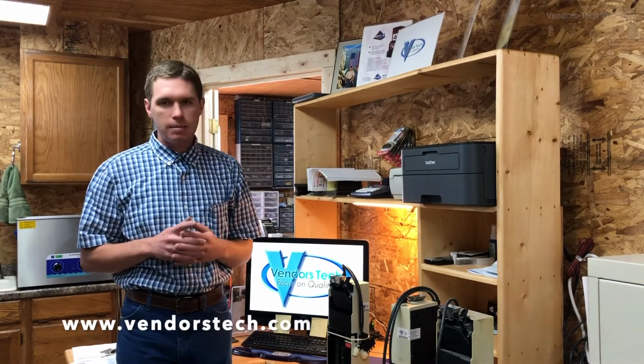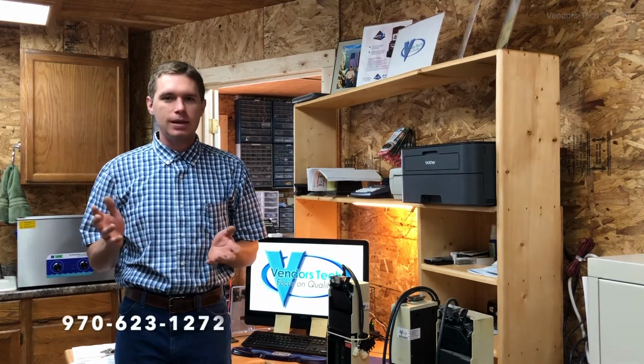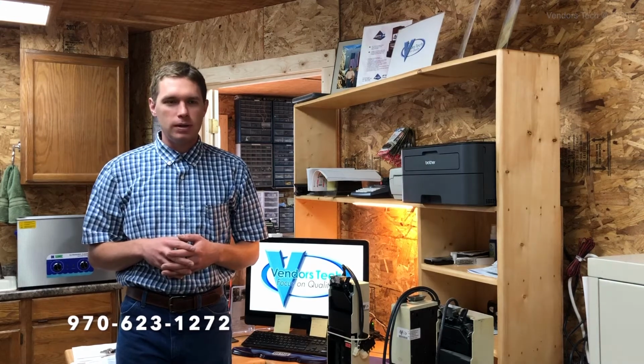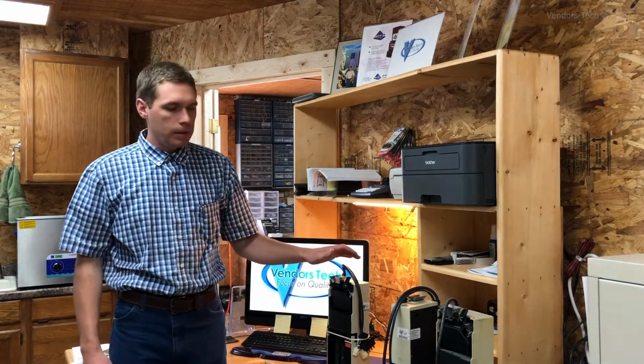Wanting to talk about the MEI TRC series coin mechs today. And unfortunately, the party on these is pretty much over. The MC series coin mechs have been junk for a long time. There's just no way to repair those. Those were discontinued way back, probably in the late 80s, early 90s or something. That's the earliest dates you start seeing on these TRCs. I'm not quite sure how long they made the MC series, but the TRCs are what replaced them, and they made the TRC series coin mechs all the way up until, I think, 2009 or something like that.